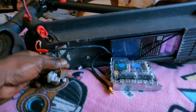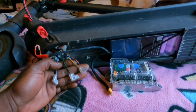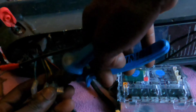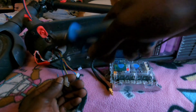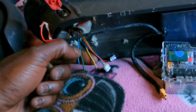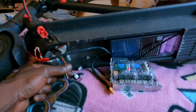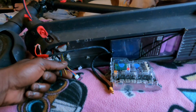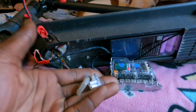I'll begin with the phase wires — they're the most obvious and easiest to find. The three thick wires are usually yellow, green, and blue. The first thing I'm gonna do is snip off these connectors because I don't have the female versions so I've gotta make my own connections. Three phase wires for every brushless motor — there are sensored and sensorless motors but that's a whole other subject. Anyway, there are our connectors snipped off with wire snippers.